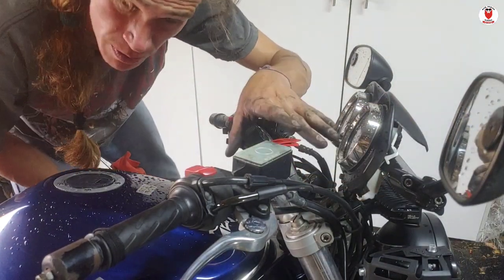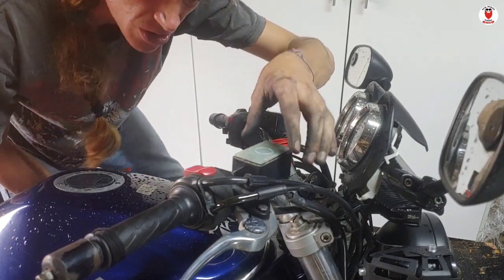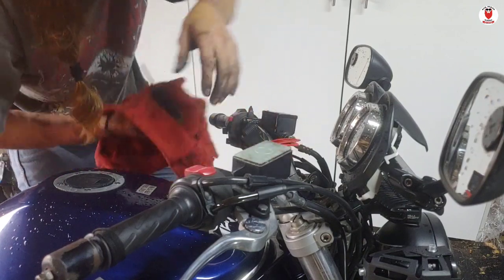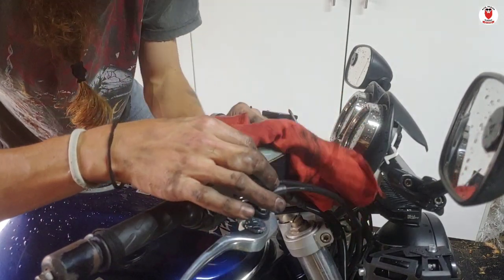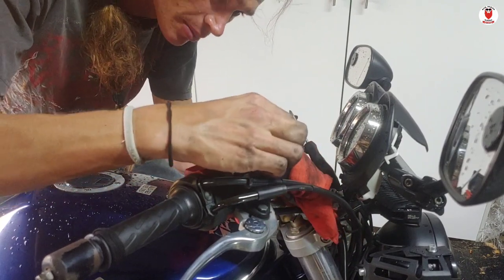When I open this cover up, I'm going to be super careful because this brake fluid is super corrosive, and I don't really want to get it all over my pants. So I'm going to keep a rag here — South African people call this a loppy — and I'm just going to keep that close by so that if there is any spillage, I can clean it up quite quickly.